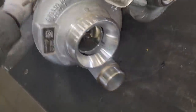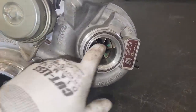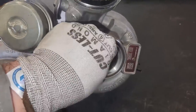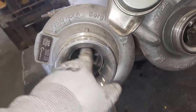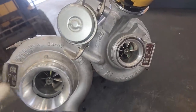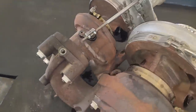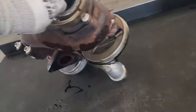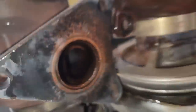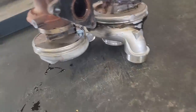Let's go take a look at it on the table. You can see the upper one, which I believe is the high-pressure one because it has a wastegate on it - it's locked up. The lower one is not, but anytime you have one bad turbo and they feed each other, it's a good idea to replace them both because you don't know what's going on there. You can see the triangle flange there on the bottom - kind of unusual. Cats are pretty much always square. One less bolt to get to was nice though.